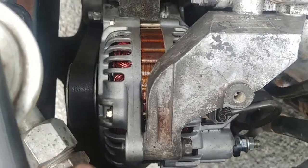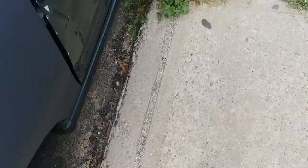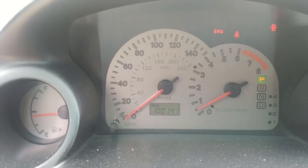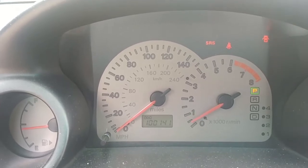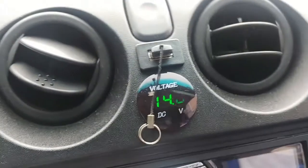Finally I got the alternator installed. It took me about an hour and a half, more or less, because the engine was still hot and still is. We're going to do a trial right now — turn it around. It's standing at 12.5 volts. Hey, we got life! Let her control the idle, it takes a little while... 14 volts.